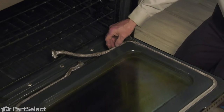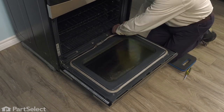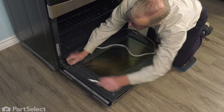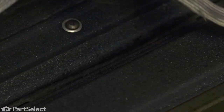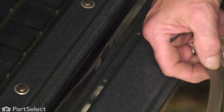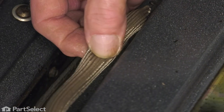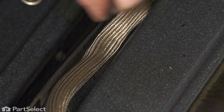Just continue to do that all the way around the perimeter of the door. Now you can remove and discard the old gasket. Next, we'll take the new gasket and take one of the loose ends — if we're going to feed from one side, we'll tuck it into the opposite slotted opening. This is where a small flat blade screwdriver will come in handy. Just tuck enough of that end in so that the first arrowhead fastener will line up with the first opening. Then while pressing down in the center of that fastener with your thumb, just make sure it fits all the way down into that opening so that it engages.